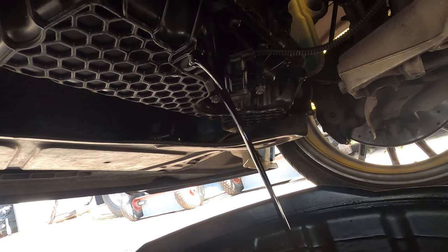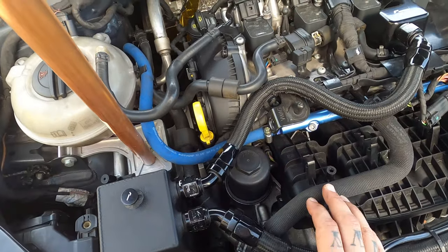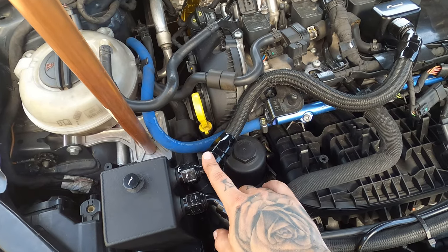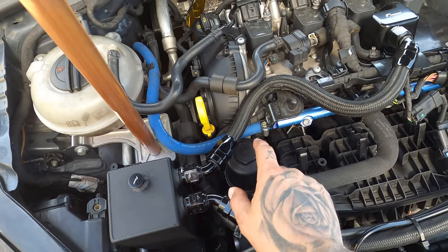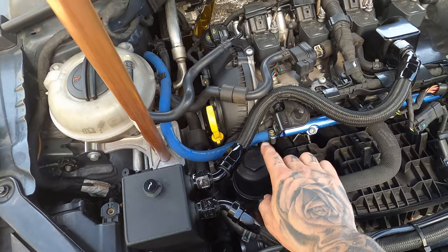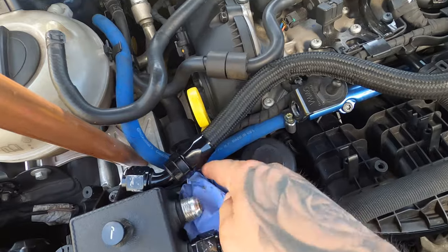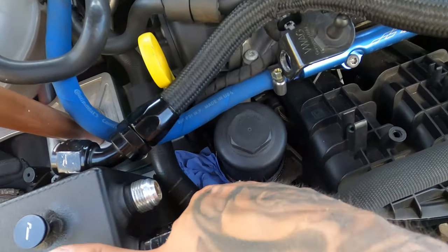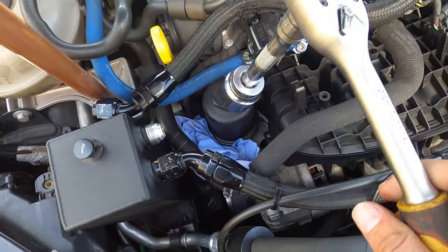Just leave it draining for a little bit. Now I'm back out from under the car — you only need a screwdriver, an oil bucket, and the other things I showed you. The oil down there is almost stopped leaking. I have to take off the oil catch can assembly first using the 32 socket — if you don't have a catch can this won't apply to you. Put some paper down here as it might leak a little.